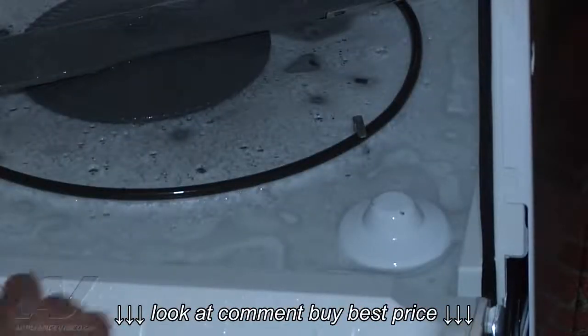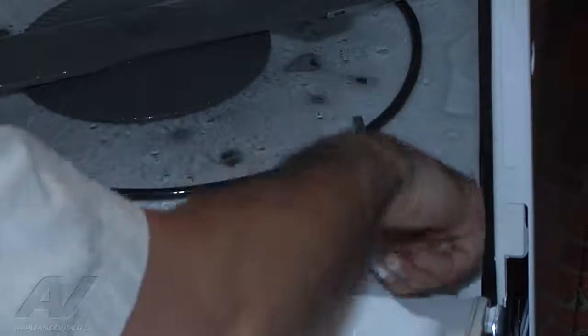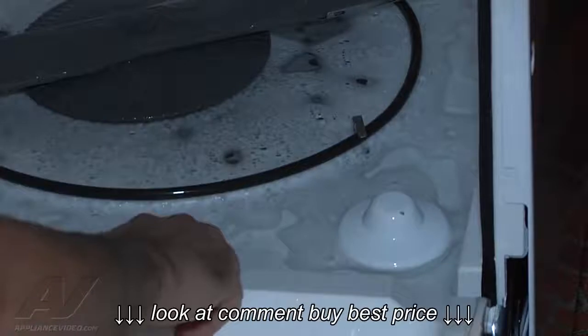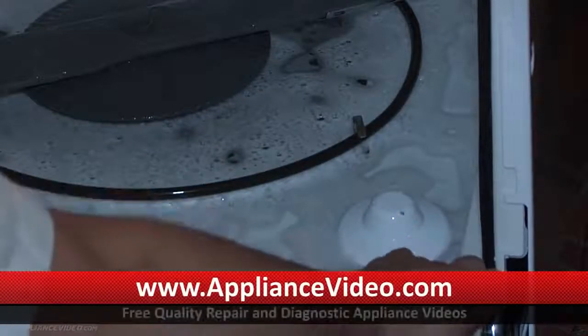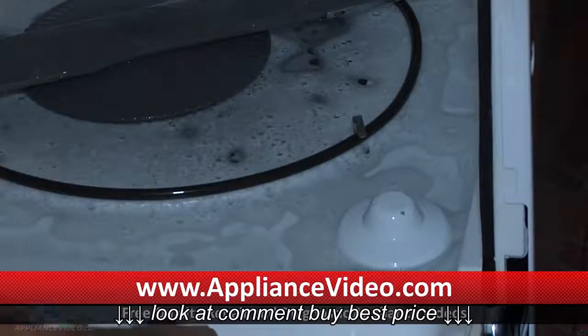What we've got with this dishwasher is the fill level is very close to this bottom lip. So if you get any over-sudsing or anything like that, that water is going to run right up underneath this edge. There's no bottom seal on this particular unit, so if you get any water running up that way, it's going to run right up and out.